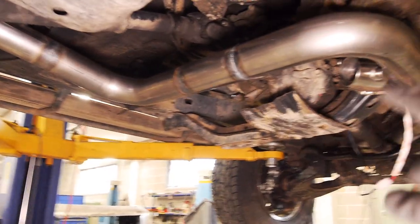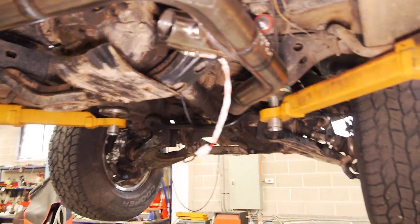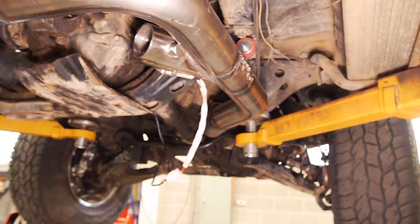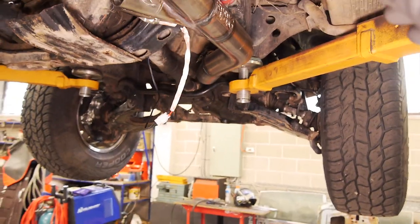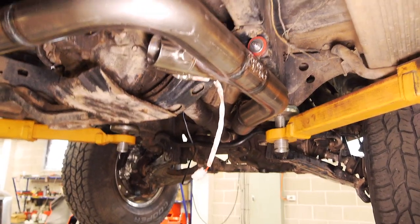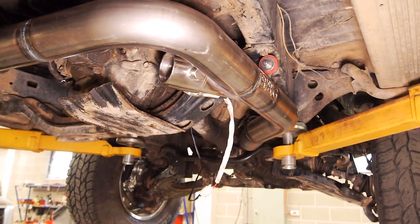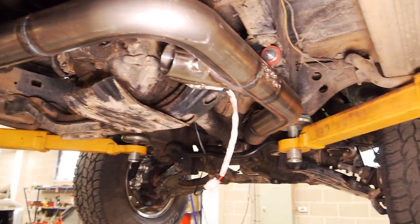So I'm going to go and pull this all off, wire brush it, clean it down with some thinners or brake cleaner or whatever I've got lying around, give it a spray, hang it up, let it dry, we'll chuck it back on the car, we'll do the baking procedure. You've got to let the car idle, etc., to bake the paint if you're not doing it in the oven, which this obviously isn't going to fit in. And yeah, so stay tuned.